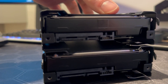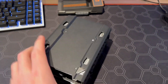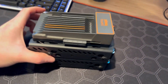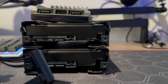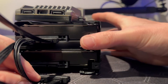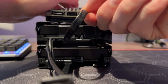The other piece of this build is the storage — we're going with dual 8TB Seagate IronWolf drives, giving us 16 terabytes of raw storage, all powered by the ZimaBoard. The four cores of the Intel Celeron and eight gigs of memory should be plenty, especially running hard-drive-based storage at gigabit speeds, since the ZimaBoard's ethernet port is only gigabit. I also had to pick up a dual SATA adapter that converts the individual SATA connectors on the ZimaBoard plus the HDD power into two separate connectors for both drives.